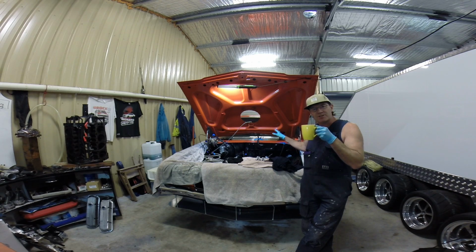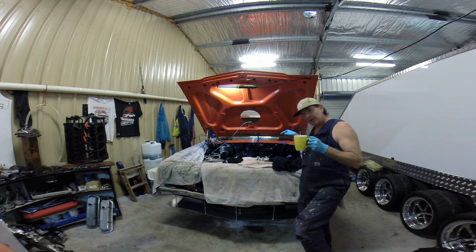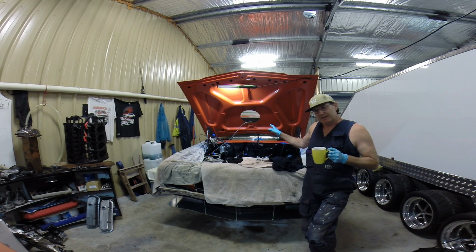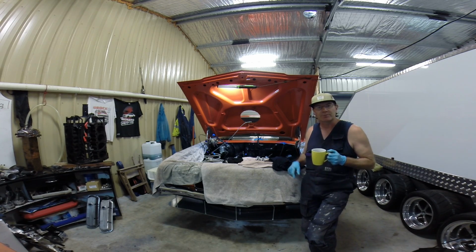Because now we're running the studs, and the thread on the stud at the top of the nut is very fine. For example, the original bolts are only 65 pound, sort of maxed out, and the bolt thread that goes into the deck is quite coarse. So we're not getting a huge amount of clamping force, because the bolt will just twist and more or less seize up on the thread, because it just can't turn anymore. It's because of the coarseness of the thread, if you understand what I mean.